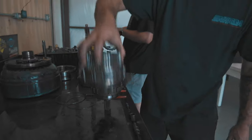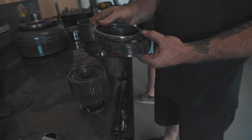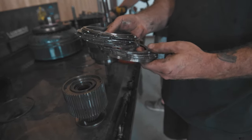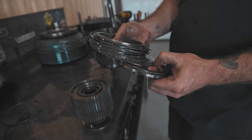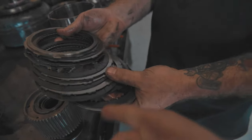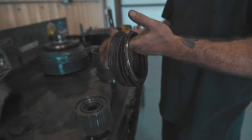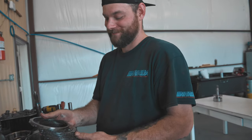And that's your final clutch kit - this is Overdrive Direct. They're the smallest, but they rarely ever fail. There's a whole bunch of them. Look at all them dudes. Yeah, and you can see how they are stuck together. You see the original marks on there too. This is pretty good. But rarely ever does this really fail. You would be surprised how far a stock friction, stock steel, stock count can go horsepower-wise. It's pretty impressive.